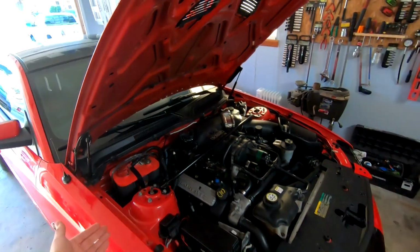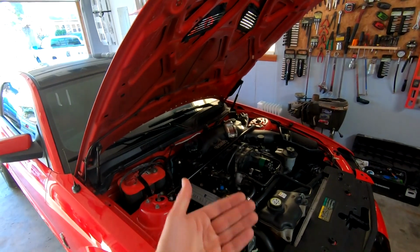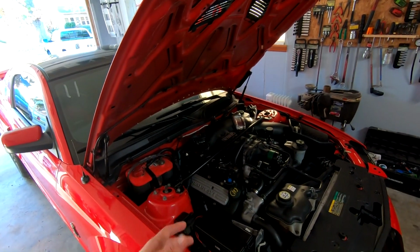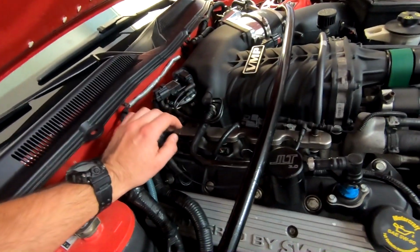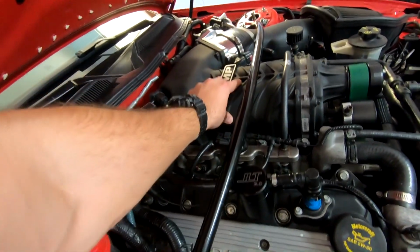I think we went up from 98 to 129, which is almost a 30-degree increase over the course of the pull. Granted, it could be more accurate than my gauge was in there previously, but it should be the same output. But I'm wondering if what's happening, the way the bypass works back here, again, I'll pull it off and show you guys later, is it kind of recirculates air throughout the blower without actually putting strain on the blower.